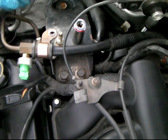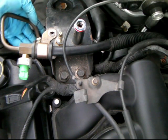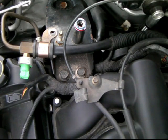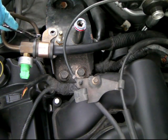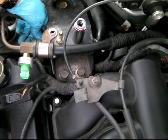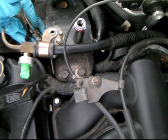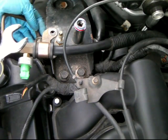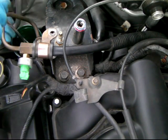This power steering line is loose - I have to loosen this out. I guess I have to hold one wrench there. Now I'm going to use a three-quarter wrench to loosen this. The power steering fluid is going to drop through here, so I'm going to put this right here just in case something comes out from this container.